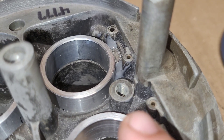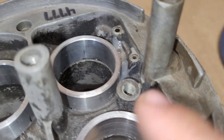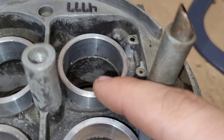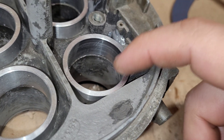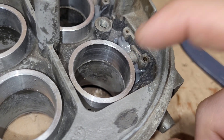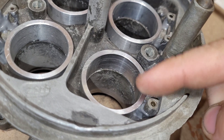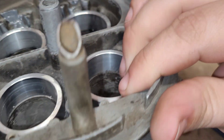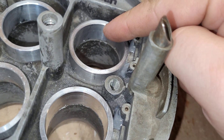We had to JB Weld underneath and fill that gap below where the booster tube came out of. Because these are essentially annular boosters — they're just bigger to fill the actual diameter of the Venturi itself. So essentially the Venturi is an annular booster. The fuel comes through here — we have a little channel machined into the back of these, all the way down.